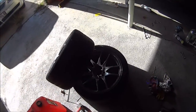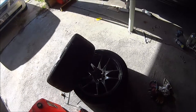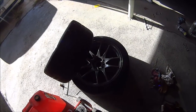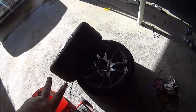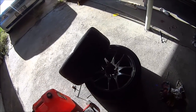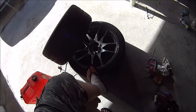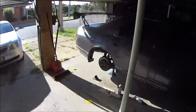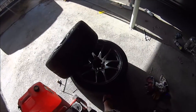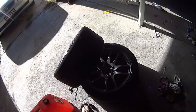For time attack, hill climb, or whatever, don't turn up with just the tires you have on the car. If you get a flat, your day is ruined — take at least a spare pair so you can put them on the front or rear and keep going. Ideally a full set, and ideally I'd also like to take semi-slick tires as wet tires to a weekend-long event.